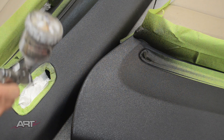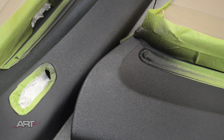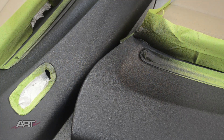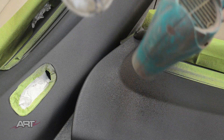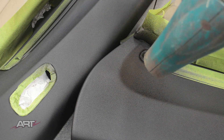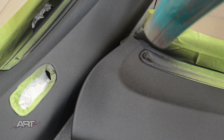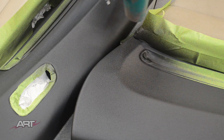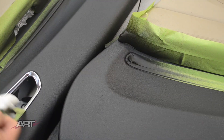Now because we're using the color as our texture, it's not quite as important, but it will affect the look of the overall sheen. When you spray a fine mist and dry it down immediately, you're going to get more of a matte finish. If you spray it a little heavier and don't dry it down immediately, it tends to lie and flow a little better and have more of a satin look. Use that idea for blending the final sheen to the original panel — you can regulate how it blends by how you apply it.